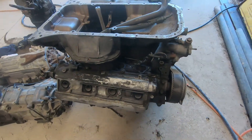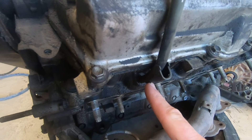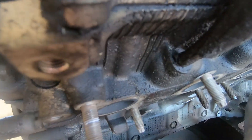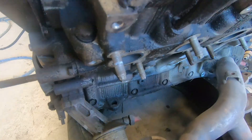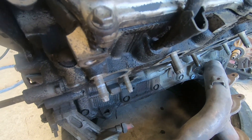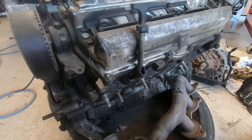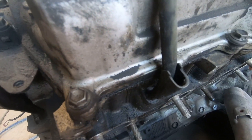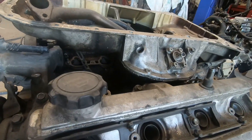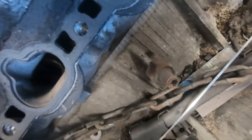I've had a build-up of engines. This is interesting — see there, that's got the dipstick going into the head. It's got a different oil filler hose, and the exhaust manifolds don't match, and the trans doesn't match. I'm fairly certain that dipstick is a giveaway to what this engine should have been. It actually came with this sump here which is not the match to the engine, but if we look down in there it gives us another clue that it's a really early engine.